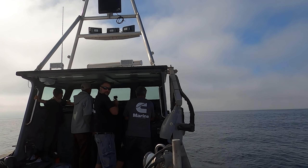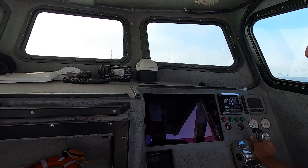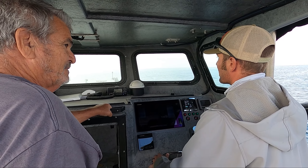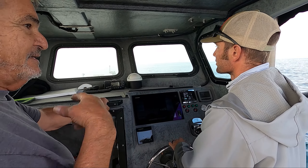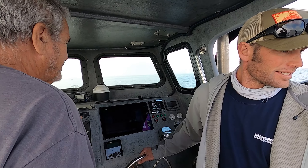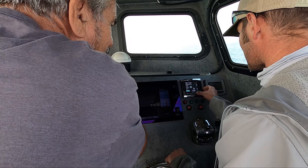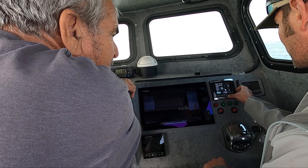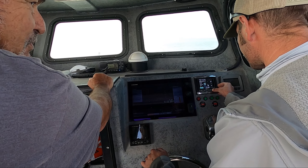26.5 — it's just not even perfect. She topped out about the same with the light load on it. That was as fast as it's gone with the single prop. What you're smelling is the wrap — it's going to smell really nasty for a few runs on both sides. How does that compare to before? Felt really good, real smooth. Let me get to fuel consumption — gallons per hour. Get to GPH. That's oil. That's how we're going to know how hard they're working. It went right to the governor — instant. Didn't even phase it. Which is what we were looking for.